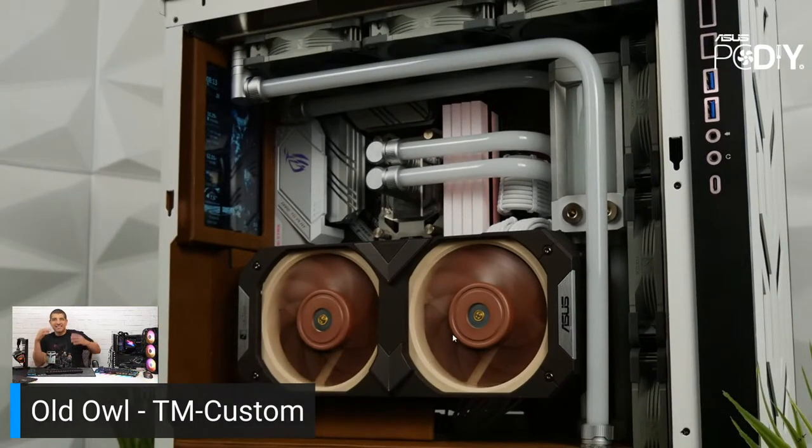Normally, I feel that eats a lot into the visual identity of the hardware. But here we can definitely see that we have a purposeful kind of design. And we also have one of my favorite designs that not a lot of people do, which is a split type design. It means that they've cooled the CPU, but they've left the GPU with the traditional air cooled configuration. A lot of times I feel, especially for higher performing GPUs, while you can get a benefit from water cooling it, it's actually more beneficial water cooling the CPU. And GPUs, especially if they have very good thermal solutions, you don't necessarily have to water cool it, and you're just adding more complexity and cost to your loop.